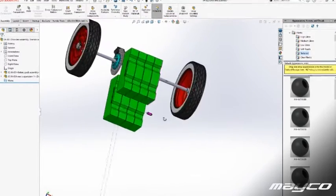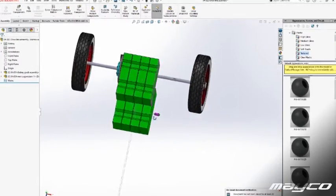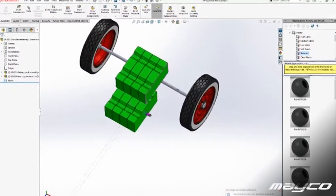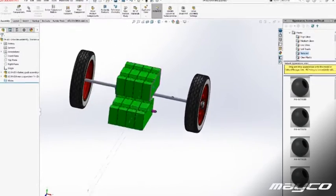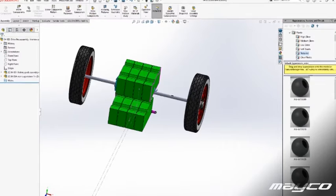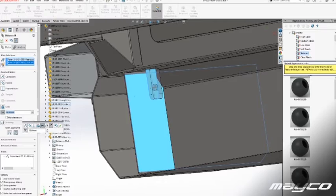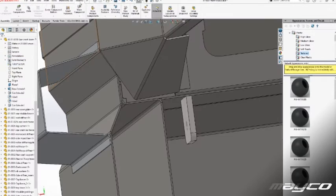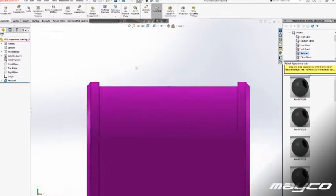So I can fit my packaging of the battery pack and the rear axle and the brakes and the sprockets for the drivetrain very closely together. The only disadvantage that I have in this whole ordeal is, of course, that I have a rigid rear axle. What that means is that you get torsion between the left and the right wheel. The left wheel can be lifted while the right wheel wants to stay on the ground. And this angle on the axle might pull a wheel inward, but also might have a bigger impact than that 40 mil that you want.